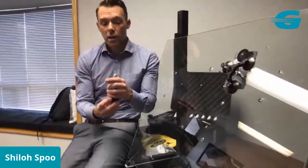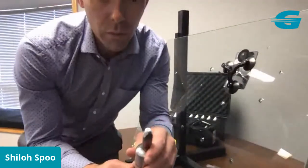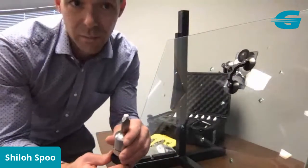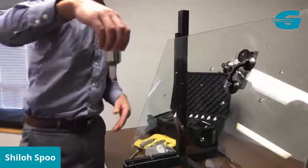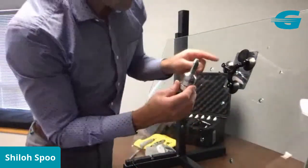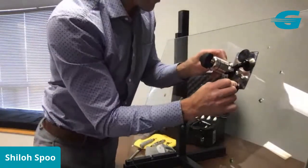Then if you're working in really hot climates, you might want to go with the 2020 or the warm weather resin. And I'm just going to bring the resin up to the base of that seal, just until it touches the bottom of the seal, and that'll keep the resin in so it won't fall out. Then those little teeth right on your zoom just line up with this ratchet pawl. So you just click it right in, boom, right up until I'm right on top of the repair.